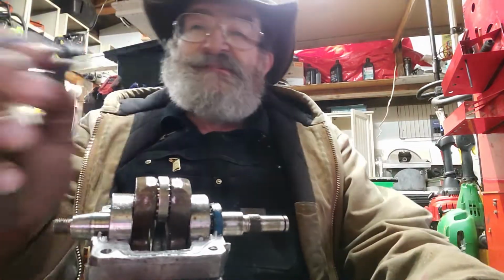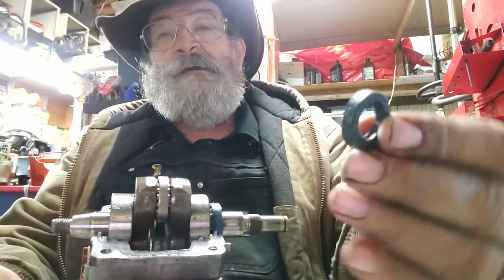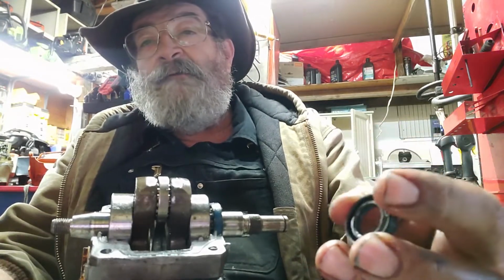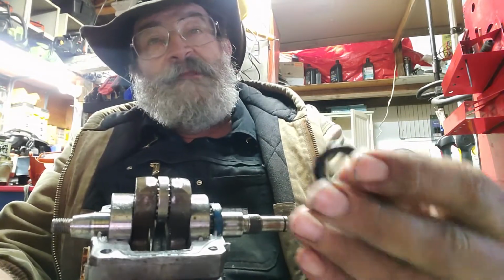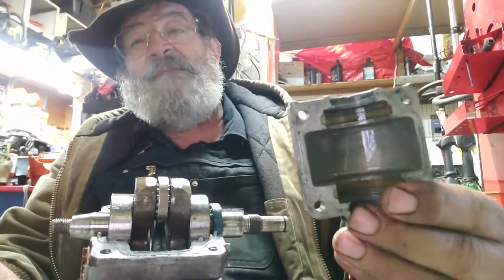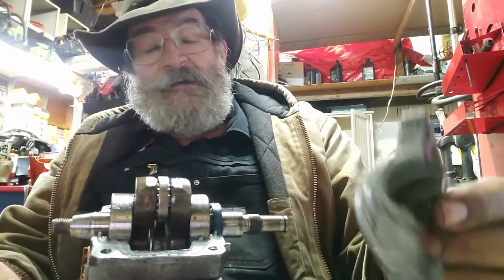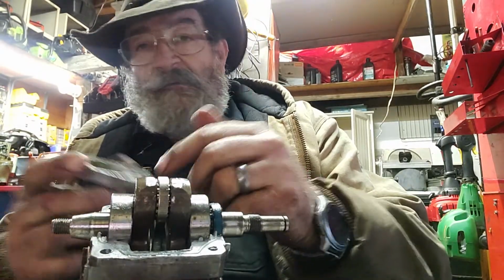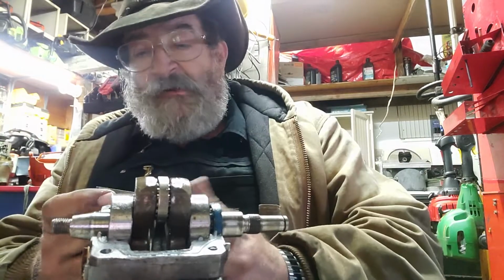So what they did was they put a couple drops of sealant on this guy. I suppose they were probably just running out in their tube, I don't know. And then they did not clean the surface of the belly pan. And so they filled this belly pan up with it being dirty or greasy or who knows what.